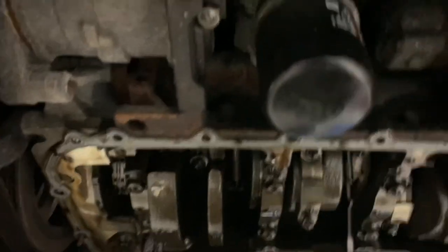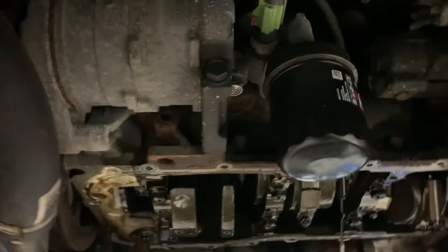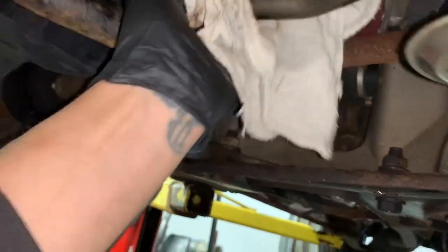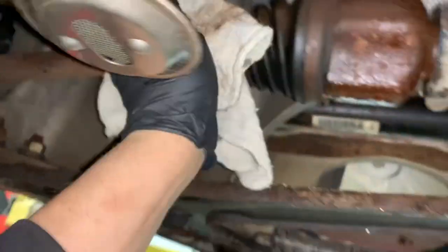Clean this thing up — just want our gasket, put a new one in. Go through here with a little bit of brake cleaner and clean the surface. If you actually need to clean it more, Milwaukee makes an electric grinder. You're supposed to use the disc with a bunch of little rubber fingers — so you don't eat that surface — but get it nice and clean.